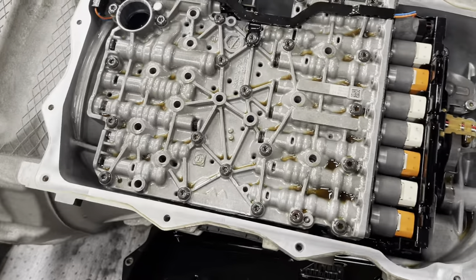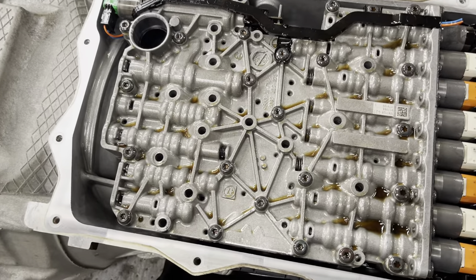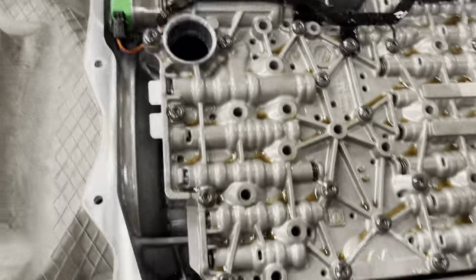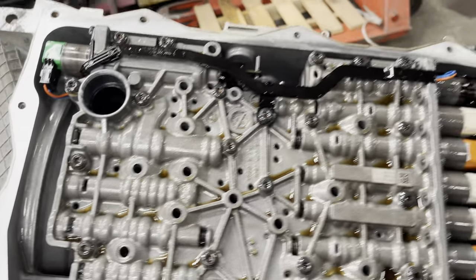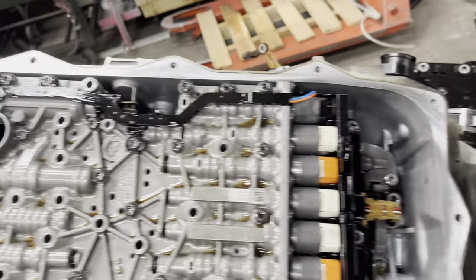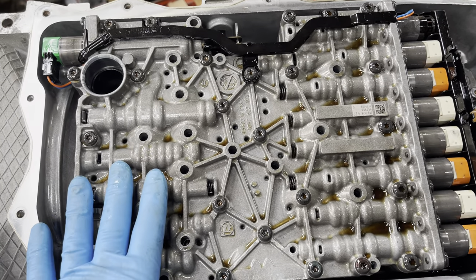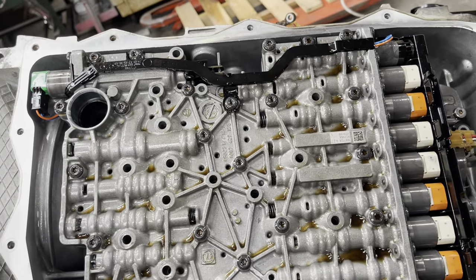This valve body is ready to come out because we're going to take the computer out of it. Torque specs, when you go to put these back together, are extremely important to do right. You should probably look it up — look at a manual for your transmission on how to do the torque specs. We're going with 71 inch pounds — not 21, 71 — on the valve body bolts. And then you've got to go through the pattern. You need to look it up in the repair manual because you are a mechanic now. Look at the torque specs and the arrangement of how it's got to be tightened — probably in the middle, work your way out, and torque it properly.